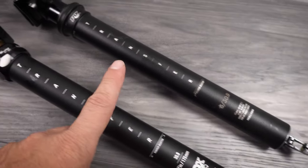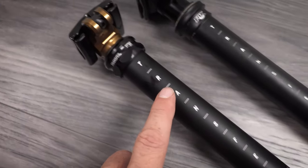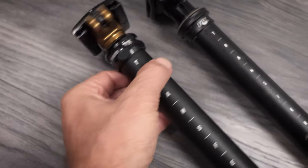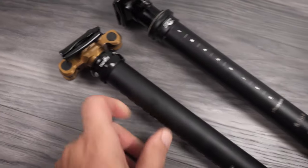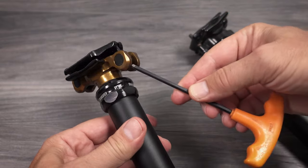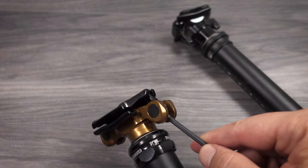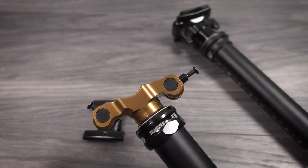The old dropper was filled with nitrogen at 275 PSI and not really user serviceable. The new dropper is still filled with nitrogen — 325 PSI from what I read — and you still don't have a valve underneath the saddle clamp to adjust that pressure. You will be able to do minor maintenance, but for full service you would still probably have to send it back to Fox. The new design also allows for very easy saddle installation — look at the angle of my allen key here as opposed to the old one, which was a typical quarter turn at a time, taking you forever.